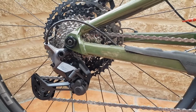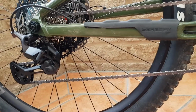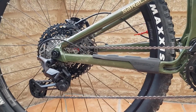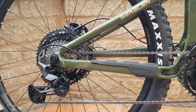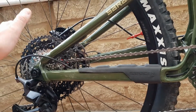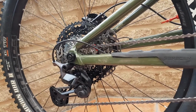look, it's an e-bike. I don't think you want to pedal this on a normal bike. And it really does feel very robust. The chain feels a lot more robust. So yeah, hoping that I'm not going to miss the 51 tooth over the 50. It's the extra tooth at the top end. It's an e-bike. I probably need to really question my life choices if I'm climbing something and that one extra tooth would have helped. At the top end, that's a 2% difference, whatever. But at the bottom end, you're going from 10 to 11 tooth, that's like a 10% difference.